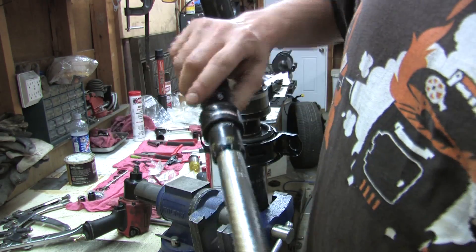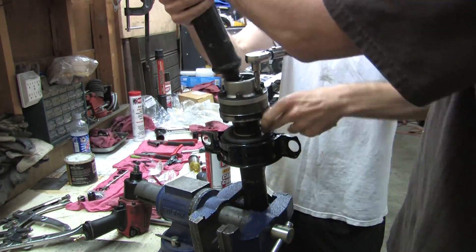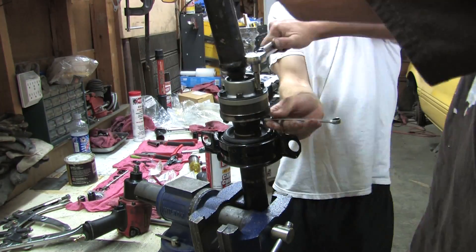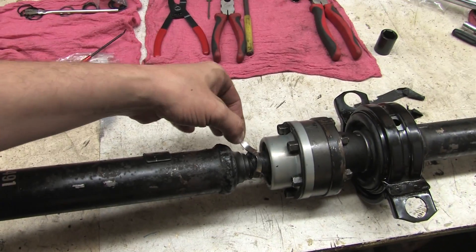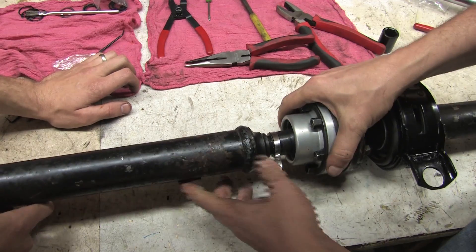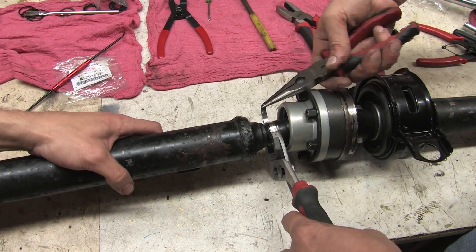This is my 7mm and we set this to 25 foot-pounds. The clip came out all bent and mangled — that's just sad and depressing, but it happens. It's metal, so let's grab this piece and bend it right on back. We've got to find the arrow on here — that arrow indicates exactly where that clip is supposed to go. Hold it in place and fold this over, lining up the arrow.